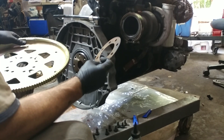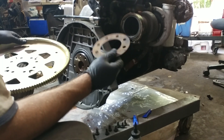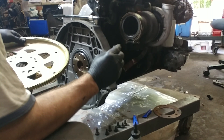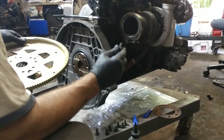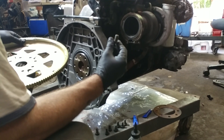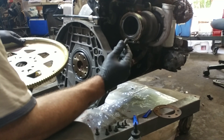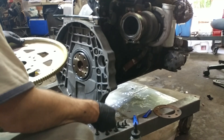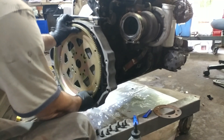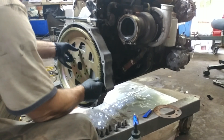With a normal flex plate you would have your ring where your bolts go through. We don't put these on when we're dealing with the double thickness flex plate, because the torque spec on these bolts is 103 to 105 — I've seen it as low as 101 in a service manual. These really get cranked down, and we leave it off to not compromise any of the length so that it gets as much bite as possible with the extra size of the flex plate.